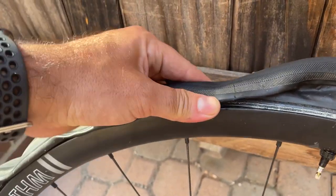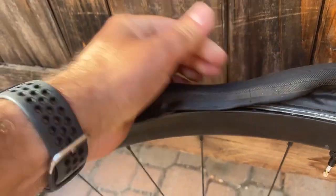As far as I know, these tires collectively should only have about maybe 600 or so miles on them. I had an issue with a previous ride I didn't film where the sidewall was leaking a little bit. It turns out I didn't have any sealant in there, so I didn't worry about it. I put a little super glue on the outside, filled up some new sealant, and it's been fine since.